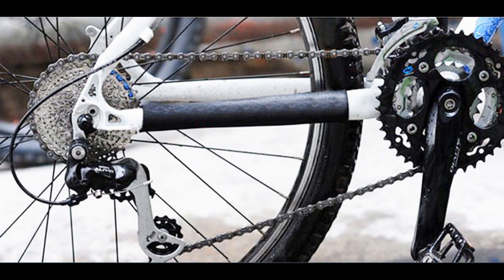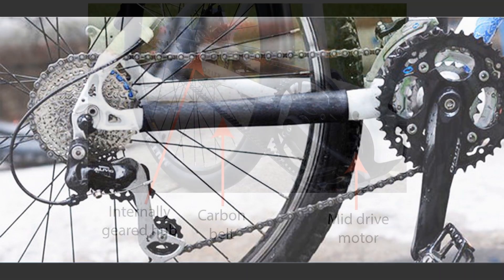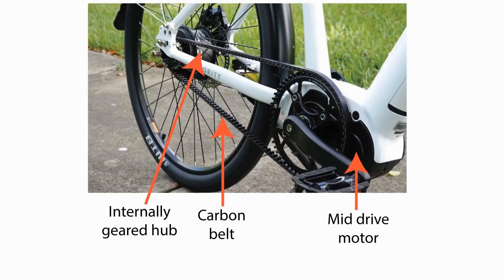The disadvantage is that the chain and derailleur have to be adjusted occasionally. Most annoyingly, cleaning the drive system correctly takes a lot of time and effort. If you fail to clean and oil the chain and gears frequently, they wear out fast. There's another drive system you'll rarely see in bicycle stores, but worth considering if you have the money and desire for a low-maintenance bike: the carbon belt drive. Instead of a chain made of metal links, a carbon belt is one single piece without any split along its entire length. The advantages of the belt are that it is lighter than a chain, it's silent, requires no oiling, needs only a light brushing with a toothbrush once in a while, doesn't get clogged up with mud like a chain would, and can last as much as 30,000 kilometers.